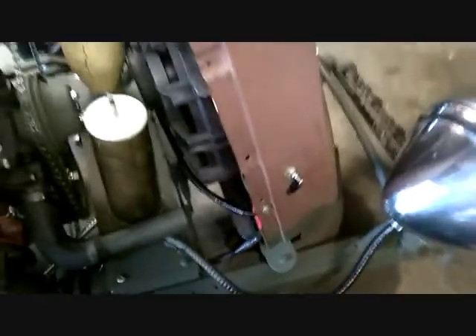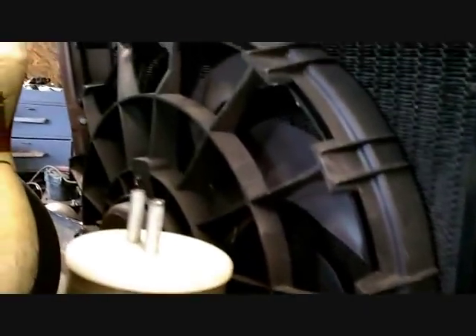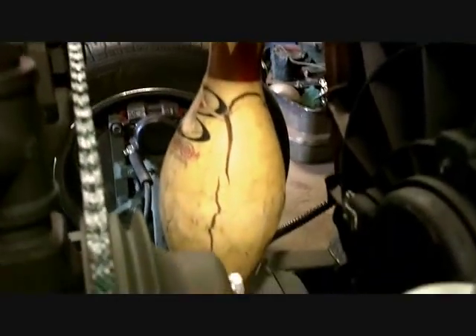There's a light that has to be behind me. All nice and clean in there. And if you stand up here, you don't see any of it. The emergency fan switch — it actually connects through the relay on the other side of the thermostat. So if this thermostat goes bad, just pull the switch and continue to drive home. Just a little trick. Look at how cracked that poor thing is — that thing is older than me, you, and this car. That's close.